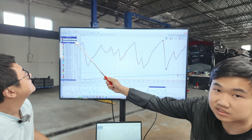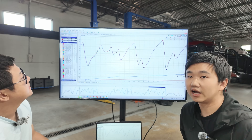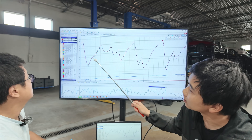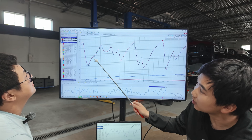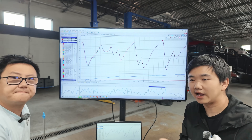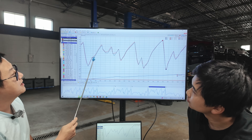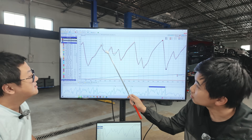Now we have the data pulled up. The red line is the 40.74 we did with camber and the blue line is the pre-camber 41.9. Turn one shows a little bit more minimum speed — about 1.3 miles per hour more — and that led to gains at turn three. There's the transition from left to right: because the car had a little more camber I had a little more confidence just to roll it in and trust the car, so the lift there was nowhere near as drastic. That small difference amplified to about a quarter of a second across the first section.